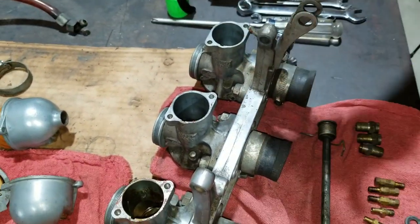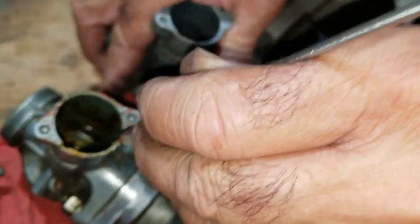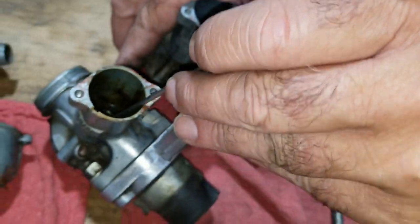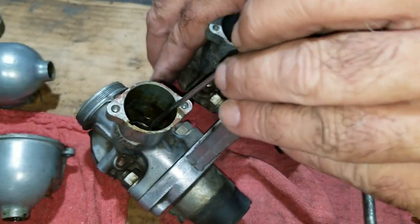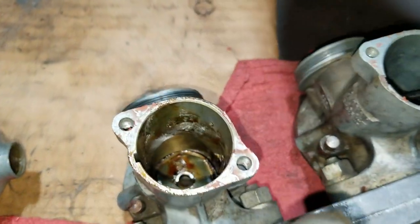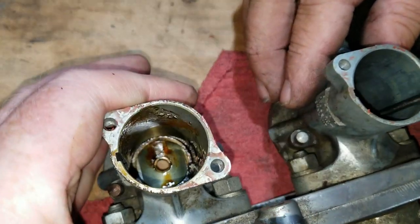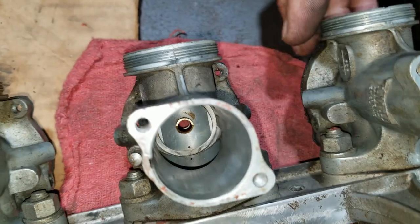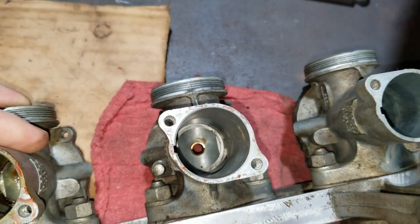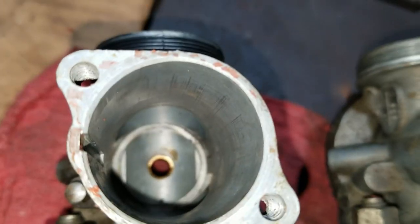Another thing that's different about the Trident carburetor is this piece that's sticking down. You know, like how the 850 was notched? Yeah, we talked about that in the 850 video. Right, and the Trident ones are cut there too, but they're tapered at an angle. See that? Maybe not in this one very well, but they're tapered. Oh, yeah, they're angled. I see what you're saying. They're slanted. Instead of being notched out, gone, they're angled.